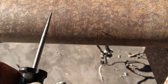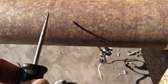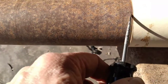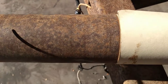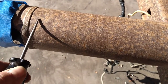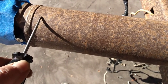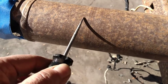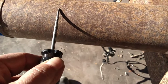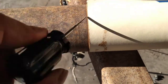Then I am going to put a sleeve inside of the cut to do two things, to strengthen it and to help stiffen it. And so this piece right here is going to be my sleeve. So over here I've got about 3 inches down here to where I'm going to run into the end of this forging down here. It comes to about here. So I got 3 inches there. And so I just added another 3 inches to it, measured from this line over 6 inches, set my paper again, and I've got another mark scribed there.